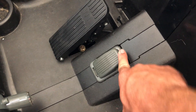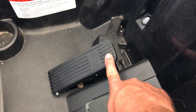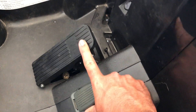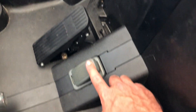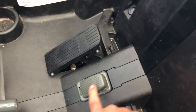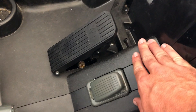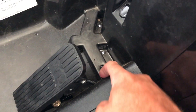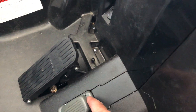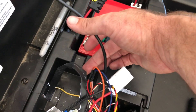We have the panels in — top and bottom. The factory switches are in, but they do nothing. This is the new gas pedal with one spring in — very easy to press. It might actually require less effort because of the leverage compared to the old switch. It's 5/16 hardware, and I drilled the hole through the side and inside to run my wires through for a nice clean look — that way you have everything hidden away.